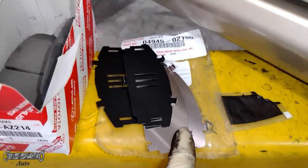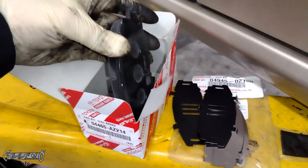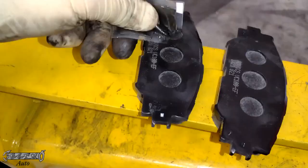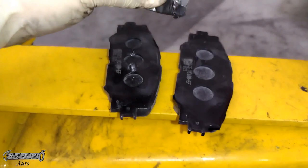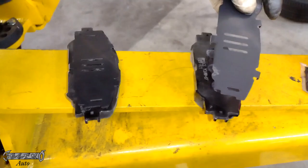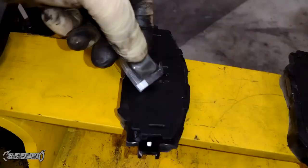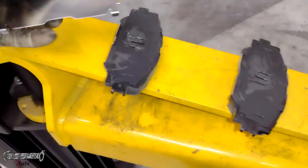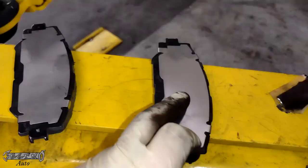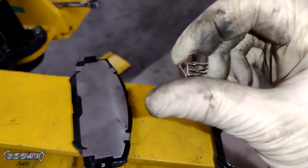Here are my brake pads - these are Toyota OEM. The new Toyota pads don't come with shims; I had to get the shim kit separate. If you already have Toyota pads on the car, you can switch your old Toyota shims over to your new pads. I got new shims so I'm putting them together. All you do is put a little tiny bit of grease on the pads, put your black shim down first on each side, then put your silver shim on top. The shims aren't on Amazon - you have to get them from Toyota. The aftermarket Evolution pads I'm going to link are also great pads and the only aftermarket ones I use.